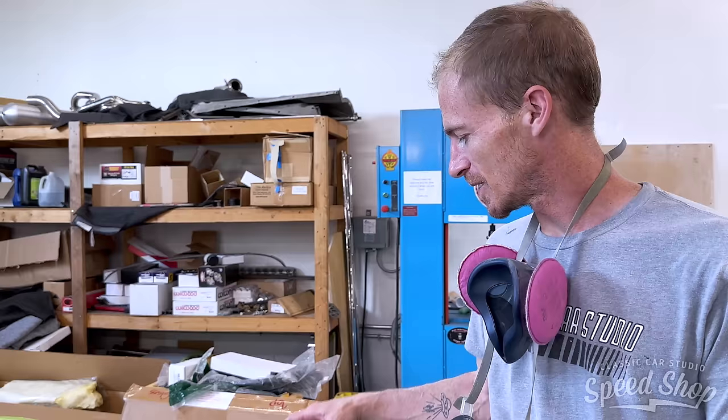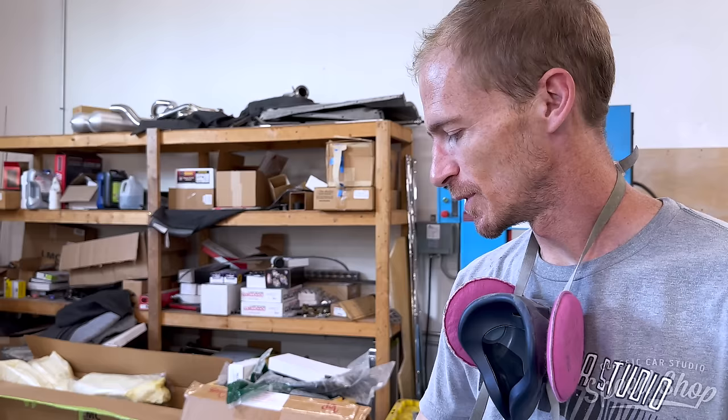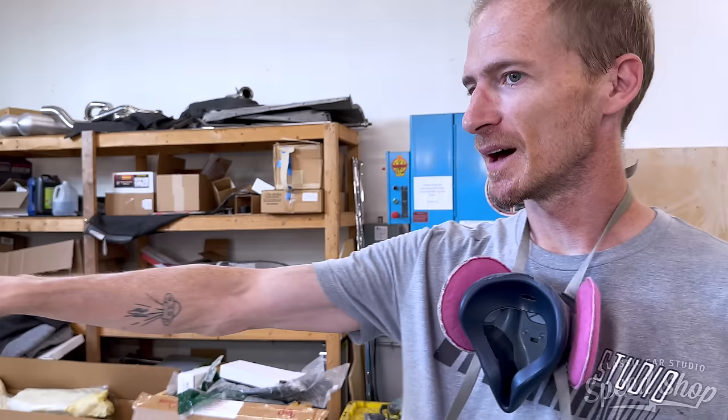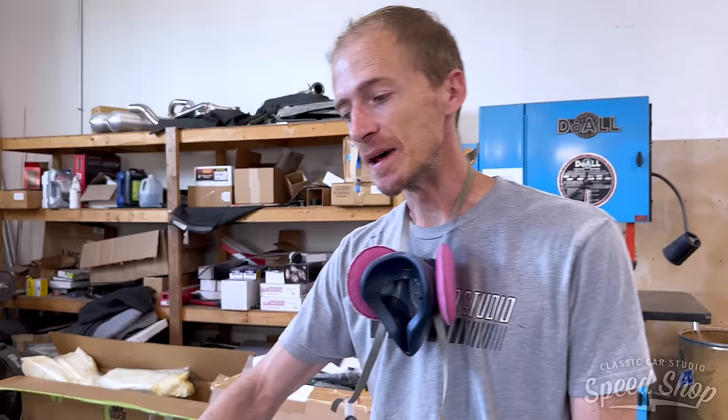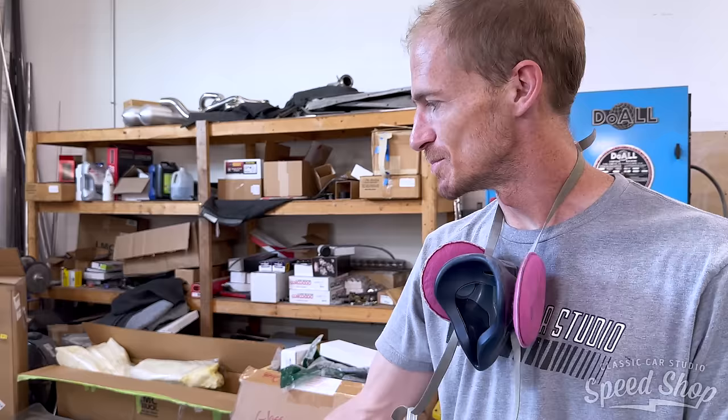Alright, so now that it's cut, I'll go ahead and locate the centerpiece up in there. I have hard mounts for each corner. The visors will come in. The rear view mirror is located. I don't know if we're going to keep the dome light. And then at the back, it's got the original wood staple blocks in the sail panel, so we'll mount it back there. And then I'm going to laminate magnets in across where the cross supports are in the underside of the roof. So this will just magnet up in there. It'll hard mount at the front, hard mount at the back, and that'll be great.